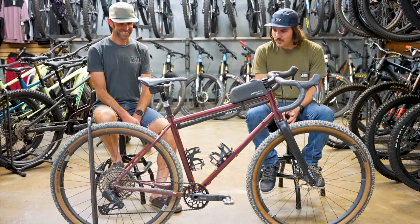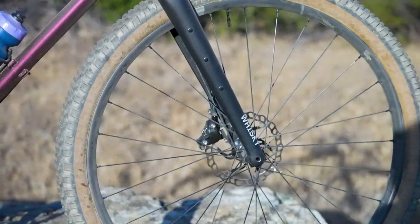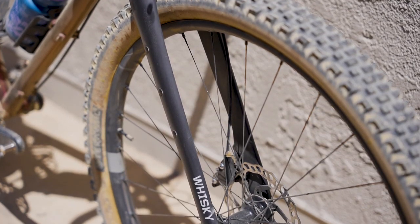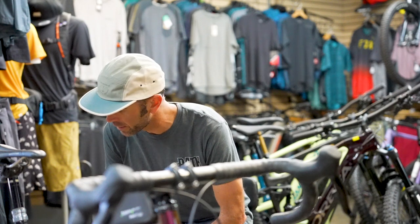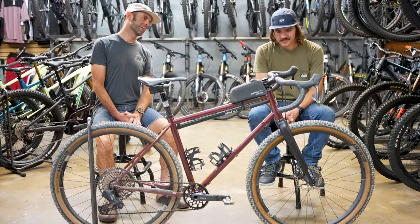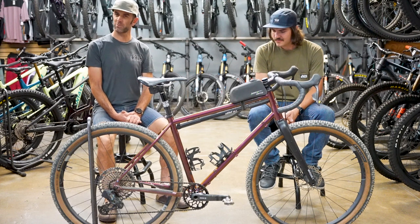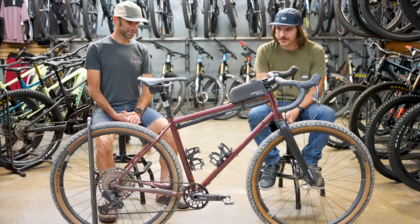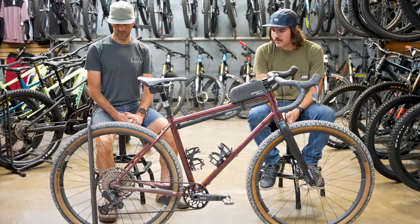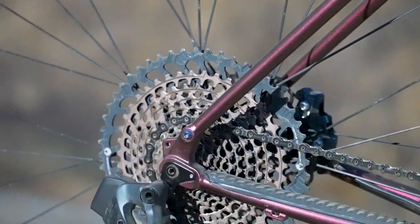So what have you done to this thing since you've had it? It's a little of everything. The frame is a 2021 Kona Sutra. The fork is a Whiskey MCX — it just happened to have the right axles, crown, and rake for this frame and still fits a pretty huge tire. The wheels I laced up are DT 350 hubs on Crank Brothers Synthesis XCT rims. Finally found some Apex AXS shifters with hydraulic brakes, which was the main thing I was waiting for to get this thing perfect. They're pretty good value — most of the AXS lineup is relatively affordable, and they work as good as anything else. The brakes feel awesome. The drivetrain is a 38-tooth oval Absolute Black ring and a 10-to-52 SRAM cassette.